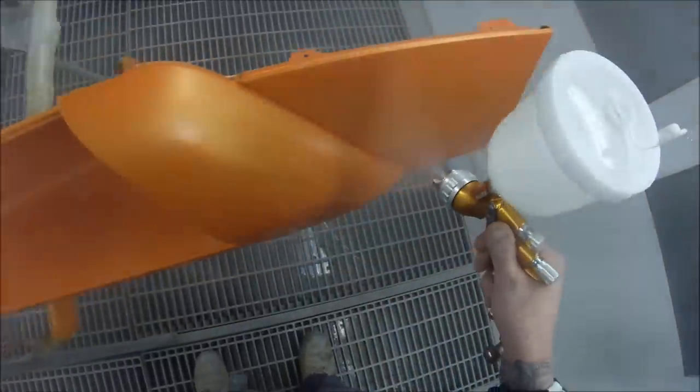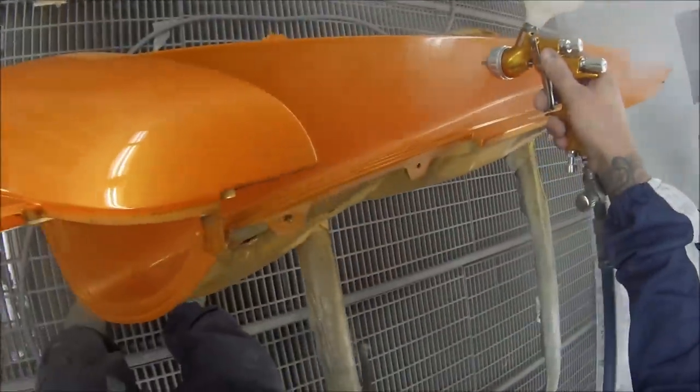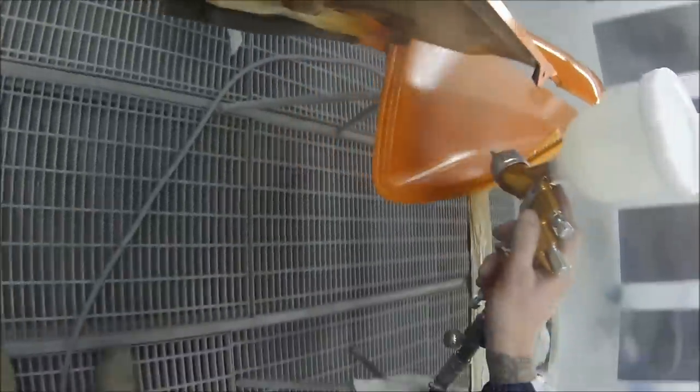I was up around closer to 2 bar here, which is about 29 psi. I've found that if you run it — as Mike McKay said — at a maximum of 25 psi you get the best results with this gun. The TE20 settings I've been using are about approximately three turns out. Adjust that to suit, as the kinds of clears and materials you're using will affect that.